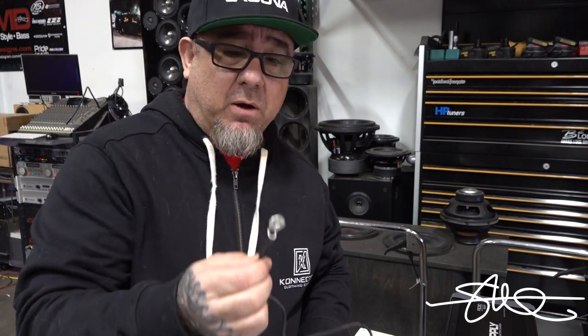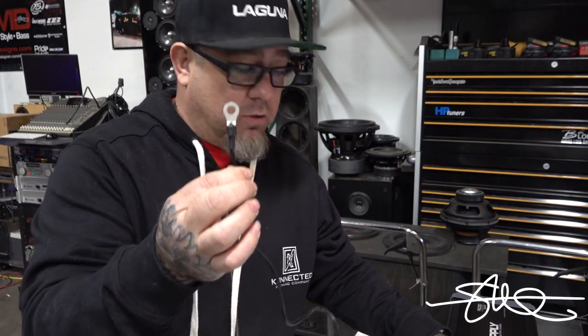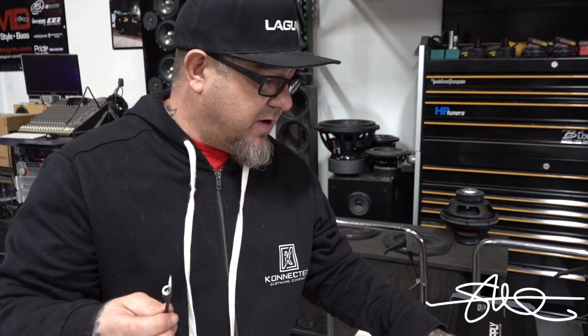But when you're using it as a power supply, this thing is just supplying and your batteries could get hot. This right here on your negative terminal will tell it it's too hot and it'll shut it down. That way you don't catch your car on fire, you don't bloat your batteries out. So it's a nice little safety feature to have. But for just charging purposes, when you're using the Intelli-Charger side, you really don't need that.